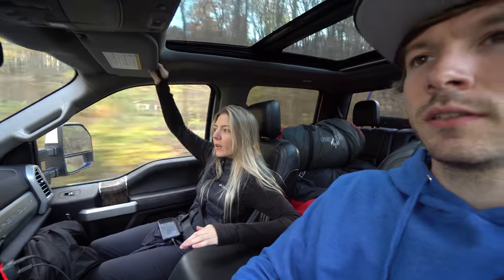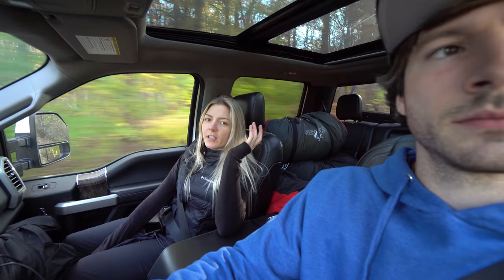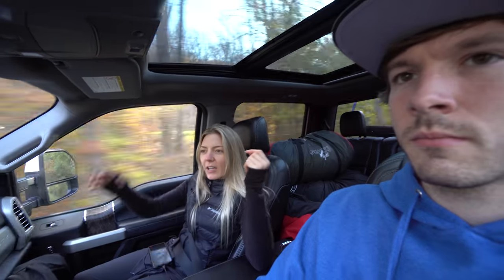So in the last video we had some trouble with the Atom-80. Jacqueline said it kind of dropped power as she climbed out. Yeah, it was weird because it did it when she ran it up too — she'd start the motor, squeeze the throttle, and it would start going, but it would kind of drop power and then recover like it never happened. So the armchair mechanics I asked for their opinion concluded it must be carburetor icing. I want to agree, but I also don't want to agree, because that was apparently an issue in the last Atom-80 model but this one was supposed to fix it. I want to say it's bubbles from the primer and I have a new primer on the way, but it's not here yet. We're going to do more troubleshooting tonight, but hopefully it's just a gremlin in the system that randomly came up and will never come back again.